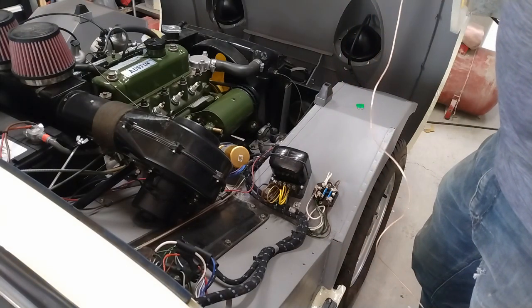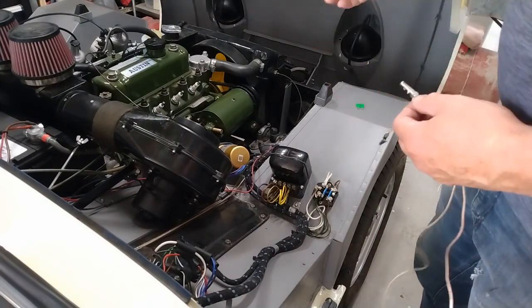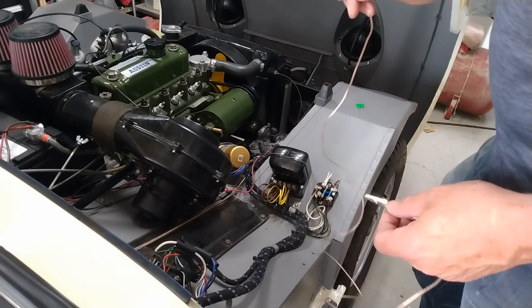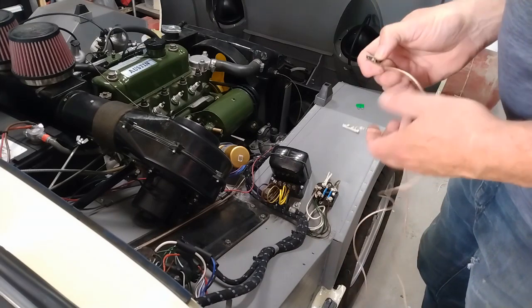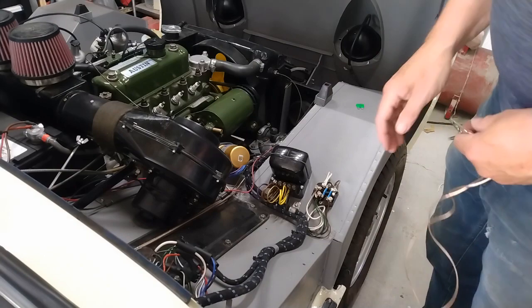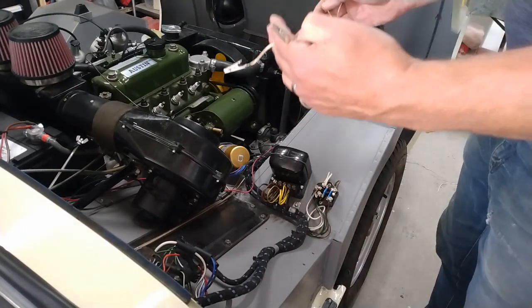One is it's been sitting idle for so long, it's lost whatever little magnetic charge is in there. And secondly, I've switched the car from positive ground to negative ground. Now I'm following a video from Moss Motors, and I'll put a link to that video in the description below. But the idea is you just use a jumper. This one's kind of long, but it's what I have.